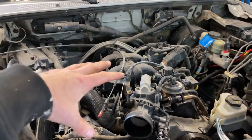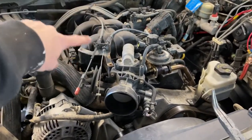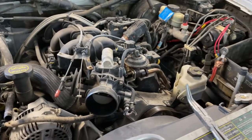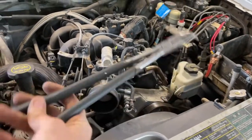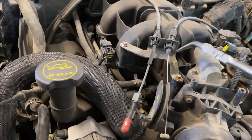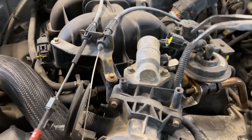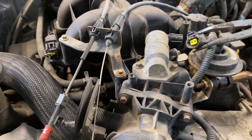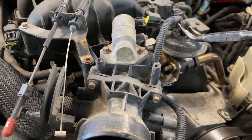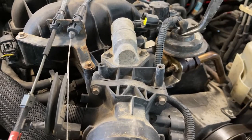I've been getting rid of a lot of the plastic and accessories. Now I'm going to blow out all around here to clear out the dirt before I pull off the intake so the dirt doesn't go down into the engine. As a tip: if you've got a set of these big long pliers with the curved tip, they're great for taking off different clips. You can just squeeze the clip and it pops right out. For hoses, don't just pull them up or you'll rip them — grab them, turn them sideways, get underneath, and lift them right up.